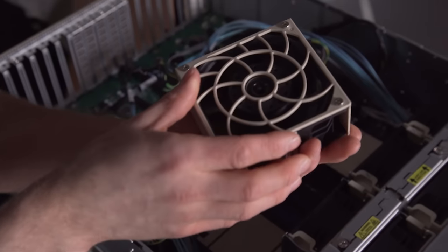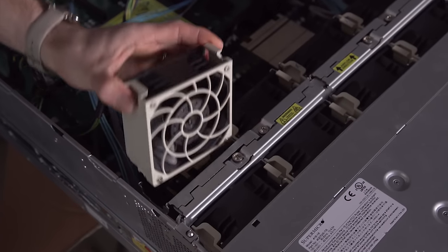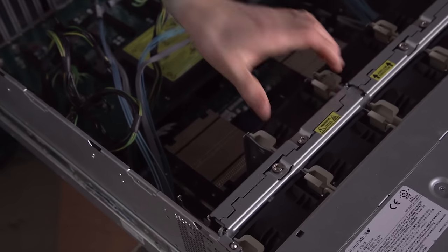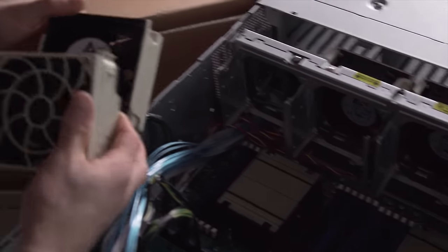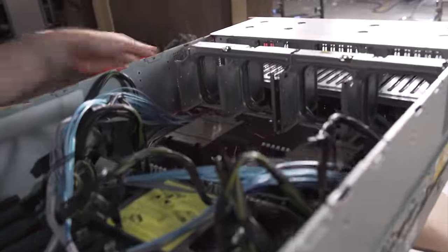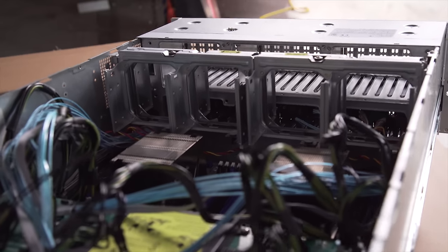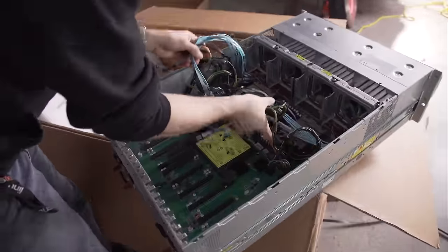This is another really cool feature I wish would make its way to the desktop - check out these fans. These are regular old 92-millimeter fans, except for one thing: I just pulled it out - where was the connector? Servers have had this forever: hot swap fans. You just thunk them in and boom, you've got little slots all over the place for all these different fan connectors. They've actually got two stacks of them, one in front of the other, in order to give these puppies pretty much unlimited static pressure, pulling all that ventilation in from these holes in the front as well as through where those SSD mounts go.